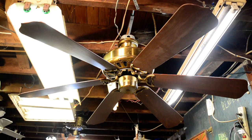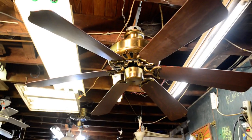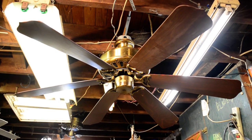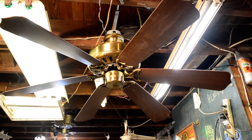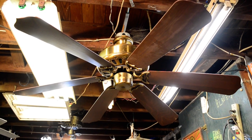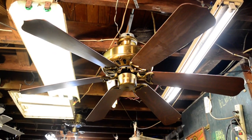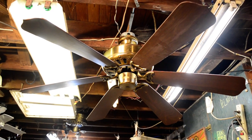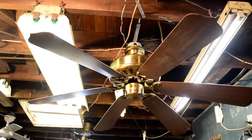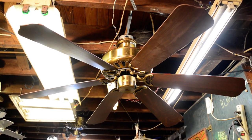Okay. What it has in it is a GE stack motor. It is a brushless DC stack motor. Very similar, or pretty much exactly like what's available in all the DC fans today. Right? Yeah, this was an early attempt at it. The theory was, yes, you would have a more efficient fan, and you do. And the problem with Superfan was it was not the motor, but the driver board, basically the circuit board driving it. Okay? They weren't that great. The technology was... the boards were crap.